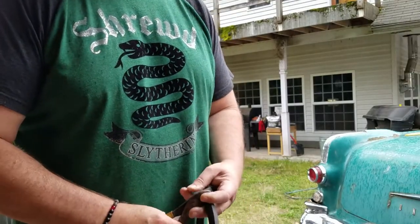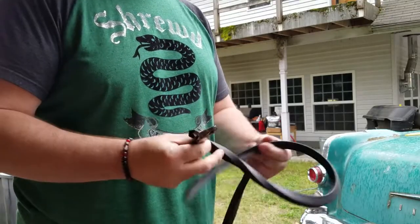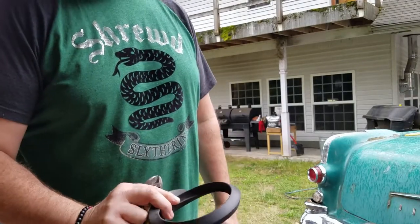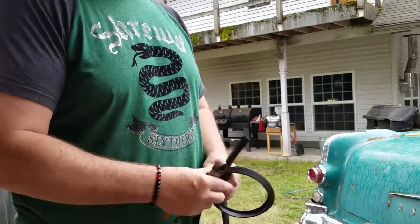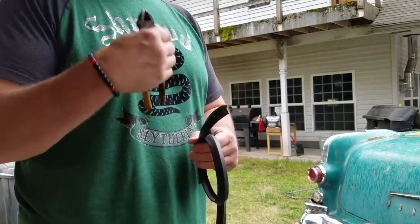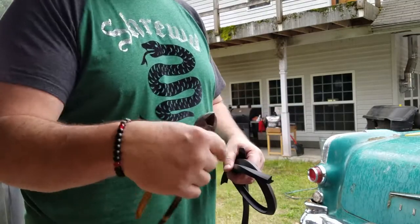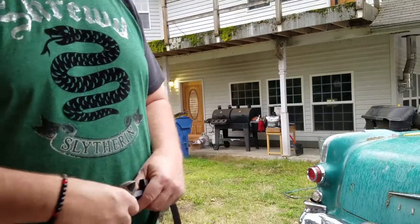Cut that. This little extra bit I will save because on the front driver's doors, there's about a foot and a half of extra weather stripping that goes along the underside of the drip rail. So in case water happens to actually penetrate between the door seam at the bottom and the top where that little wing window is, it actually rolls into like a little tray and down. But if it gets past a little tray, then there's an extra little length in there to guide it to a small hole and it empties in the door.